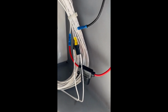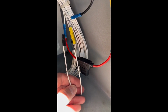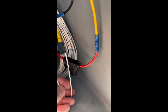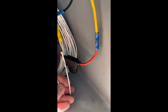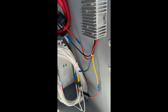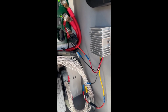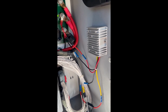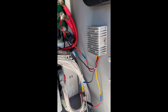And then what you see here are the clipped off wires of the 5 volt power supply and the ground, both labeled there with the smart wheel. So we've taped them off, and we're all set with our installation. We're going to go inside and check to make sure that the wipers work, because I had lost them completely, and we can flash headlights and start her up and see if the cruise control is working.